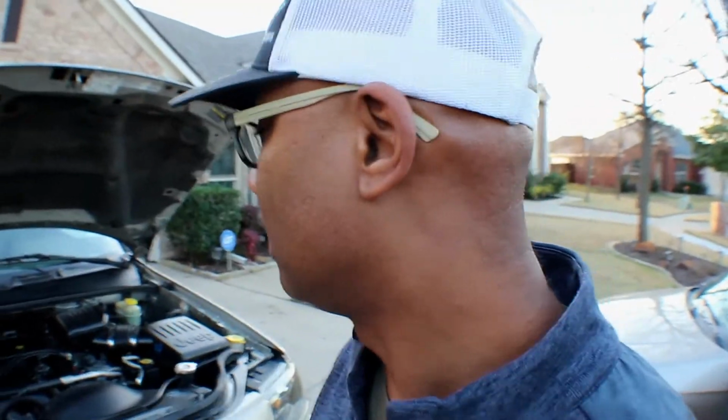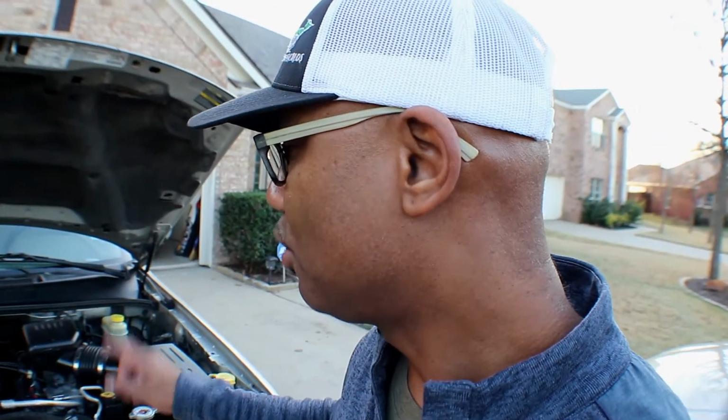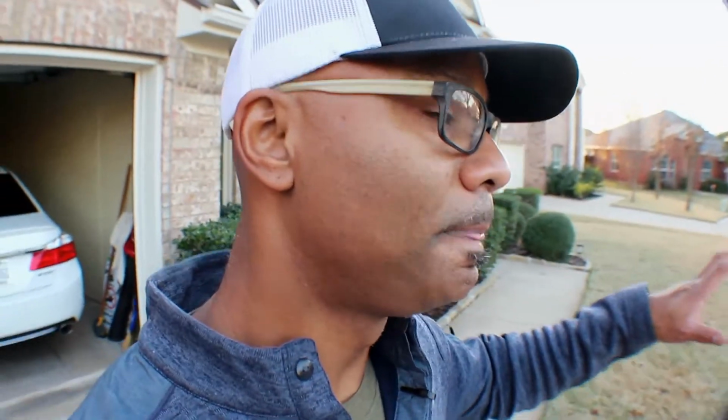So with the Jeep, I'm just going to go ahead and order a new oil sending unit so we can get that knocked out and get this out of here, because this will be sold. And one of the other things is, I think it's missing. I don't know if it may be one of the injectors, or it just needs to have the pedal put down, because after I keep starting it, it's starting to actually run a little bit better, but I can't let it run because I have no water in it. And these engines heat up immediately. I mean, really, really fast. So other than that, that is it. I am done with this until I get that oil sending unit. I'm going to order it probably today, probably get it Friday or Saturday.